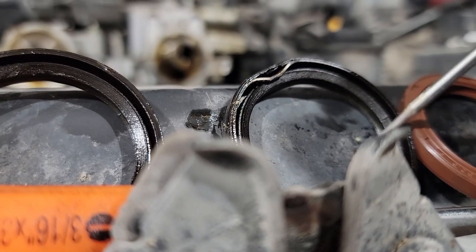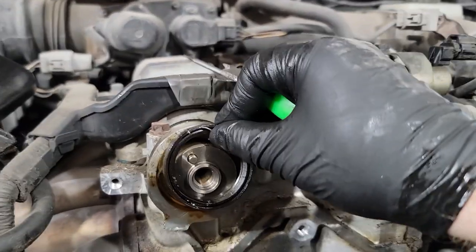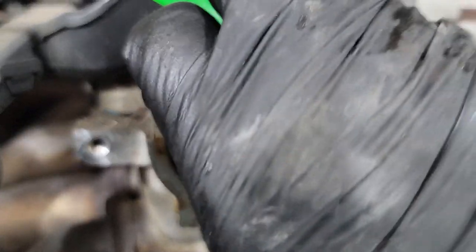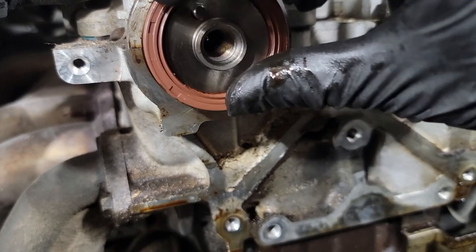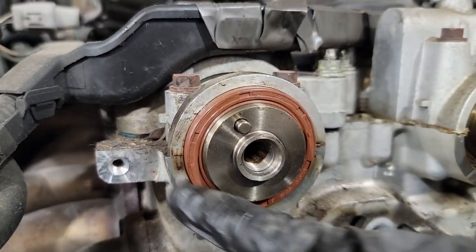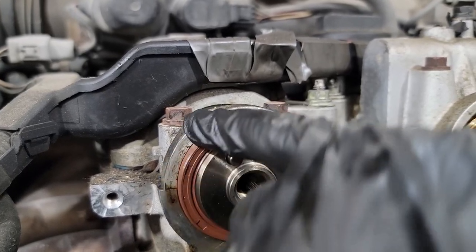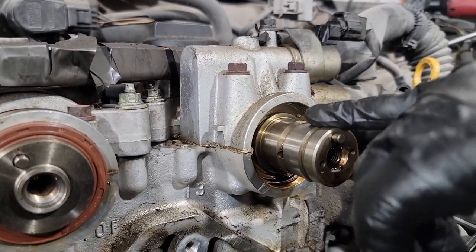That's the reason they leak and go bad — this rubber is not even rubber now. All of the moisture has been removed from it, it's dried up, it's gross — you can even see it's cracking right here. This is basically a piece of plastic now. Unlike the new one, where you slide it on — make sure when you put this on you don't flip the seal inside out. Get it on properly and make sure you put the open end towards the back. You can see the rubber is sealing because it's flexing. Tap it in using the butt of a wrench or your ratchet, just make sure it's all sealed and seated well. The other one is really easy because the VVTi gear is what seals against it, not the cam itself.